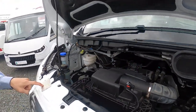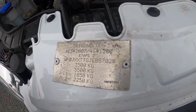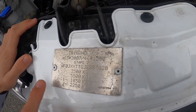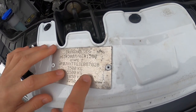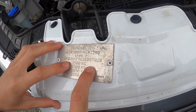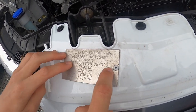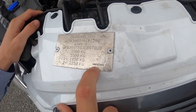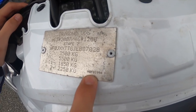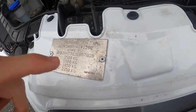Your weight plates here — it's three and a half ton gross vehicle weight. If you were to put a trailer on and tow anything with a tow bar, you can tow up to a max train weight of 5.5 ton. You've got your front and back axle weight, your Ford chassis number, and your HOF number which is your unique build number. If you ever need parts for the vehicle, just quote that number.